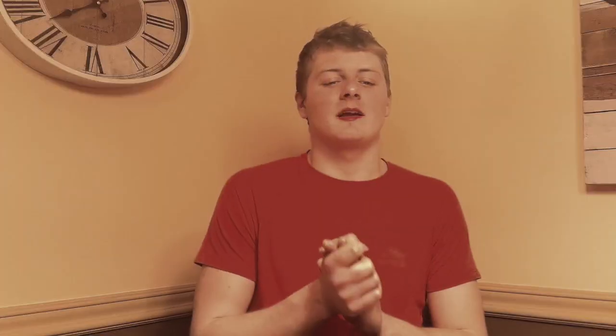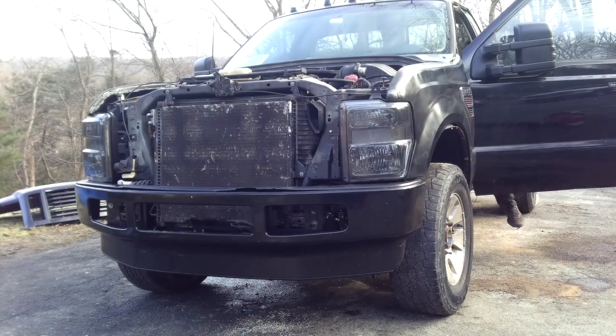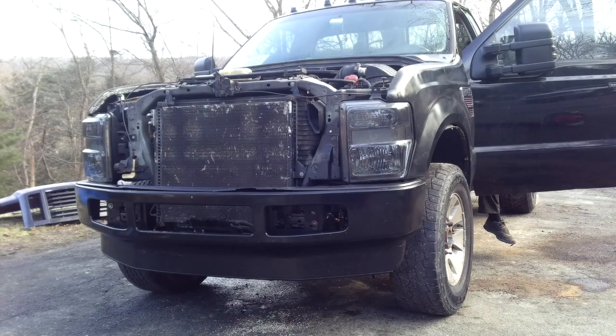You can see it's just flash weather - randomly starts sleeting out here in Jersey. We are at the point where we're ready to start it. The starter is not engaging - and unfortunately this first time I went to start it I had put the starter on backwards. It's a two-bolt starter and I put it in the wrong holes, so it was not engaging. That was a little bit of a surprise. Felt kind of stupid after that.